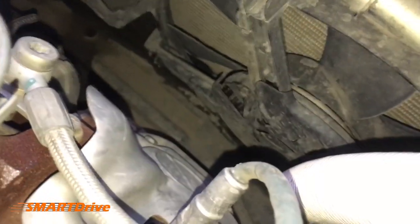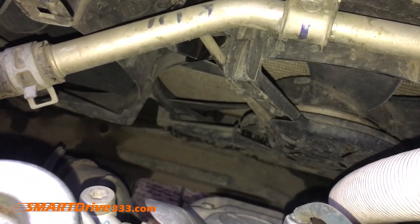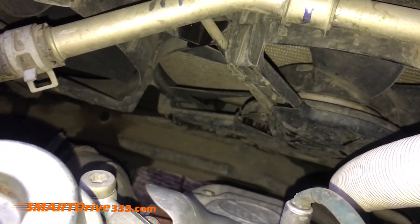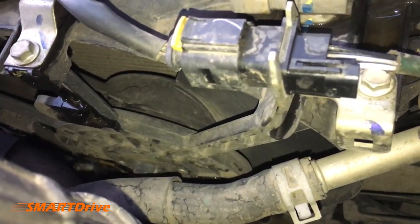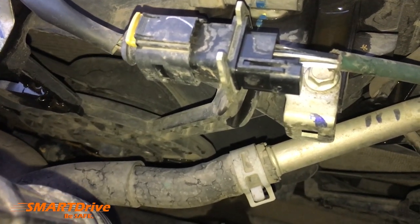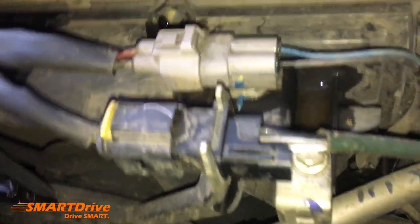As you can see, for both radiators we have different grills and different fans. Usually one fan starts when the engine performance is high but the speeds are low, to match up the cooling, and the second one starts mandatorily whenever you start the air conditioning system. So both the fans operate automatically, so we don't recommend putting your hands or fingers inside the fan while it is switched on. And we have lots of switches and wirings over here. We'll be discussing this soon.